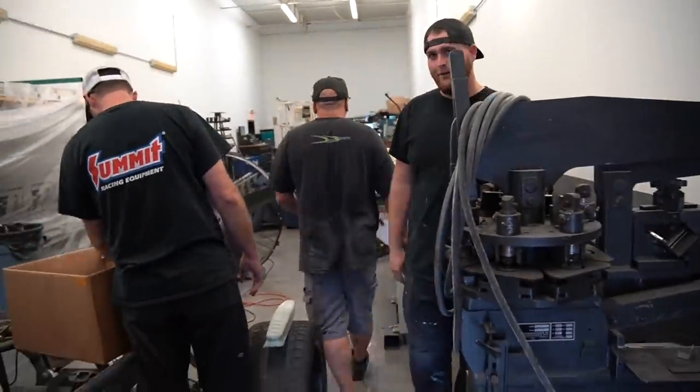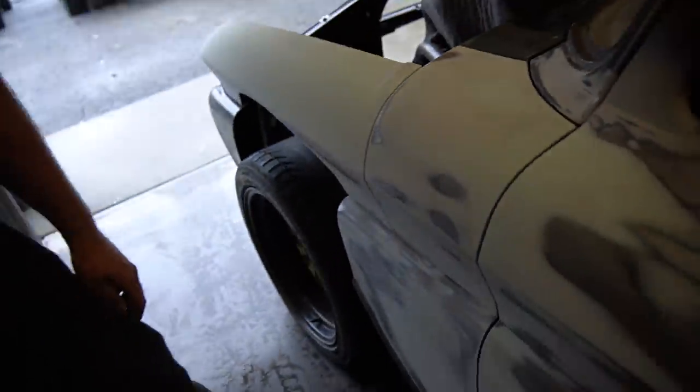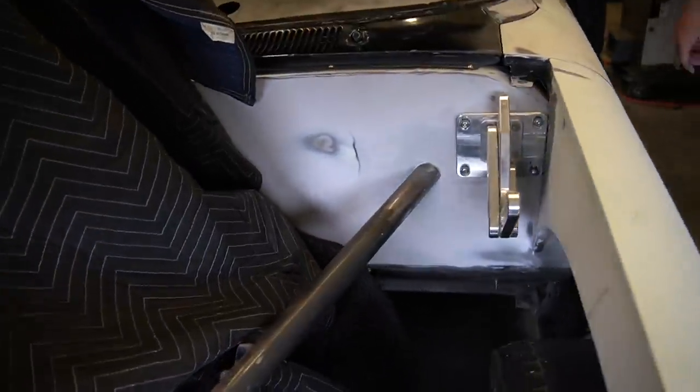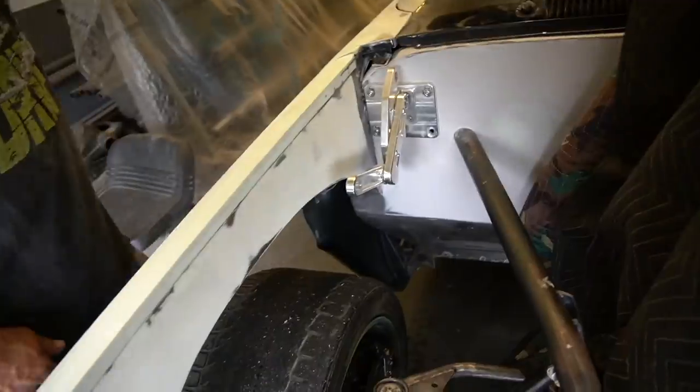Full rundown — going body work through the truck. Where is the truck right now and how many days do you think we've got? It's pretty close as far as getting roughed in. We still have a few things to tune up. Hope to have it in primer on Friday — that's the goal. He's gone through and done all the body lines. The drip rail is a little uneven so Josh is going to true it up. I'm going to sand the dash, get it ready, and we'll roll over and get this thing in primer on Friday. There's still so much to be done — the firewall still has some work. The paint's going to take the longest because we're going to have to take off the fenders.